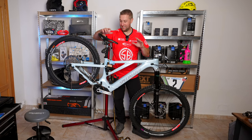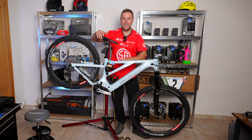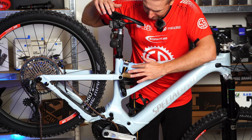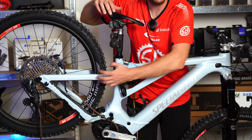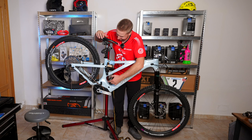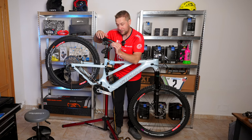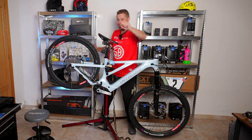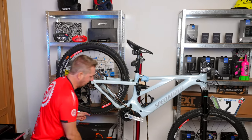I hope you're still with me — it's been a long video. We're at the last stage now. I've taken out the shock to compress the suspension. If you've got an air shock, you can just take the air out. I've got a strap with paper towel underneath so it doesn't scratch the frame. I've compressed all the rear suspension because what we're doing now is getting the chain length. This chain has come off a Kenevo SL, so it should be the perfect size — but unfortunately, it is a little bit too short.